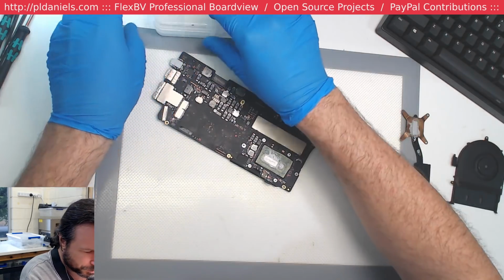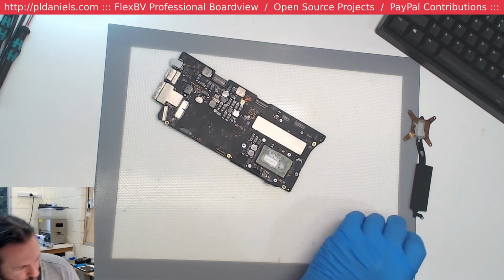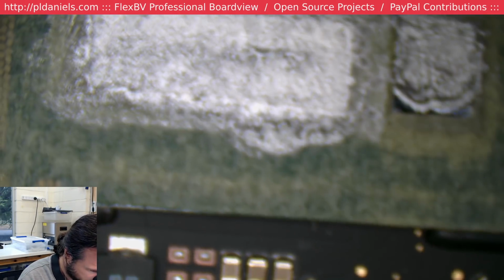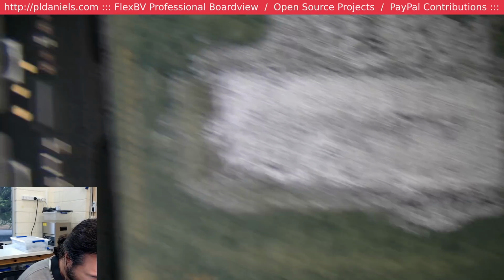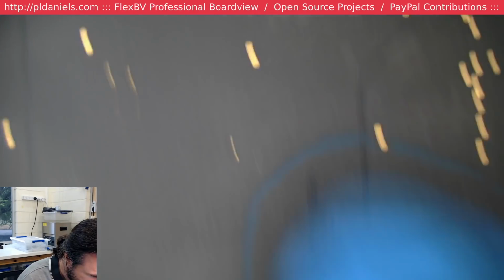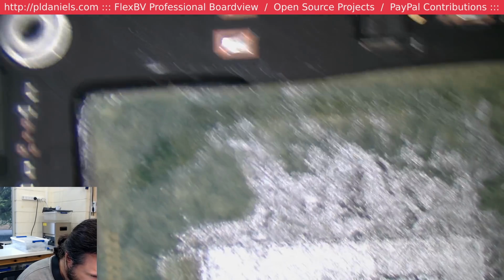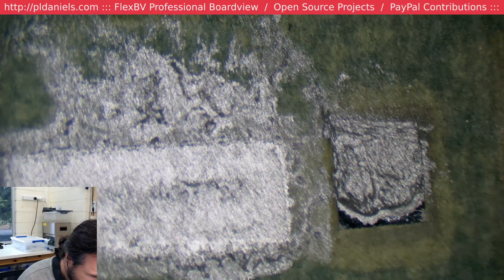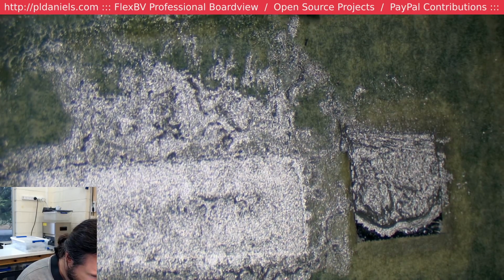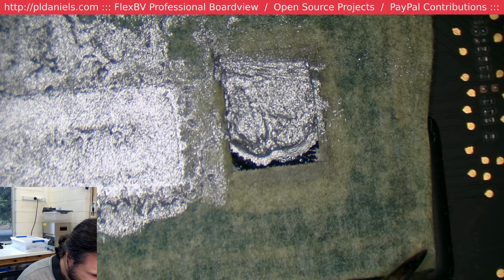Okay, let's see what they've done with that CPU. I do not advocate the use of these metallic type transfer pastes. They really do not contribute meaningfully to the operational capacity of these machines, and all that usually happens is you get all this crap happening everywhere. You get, oh look, transfer paste everywhere. It gets everywhere. Don't use it. It's a false sense of repair, as it were.